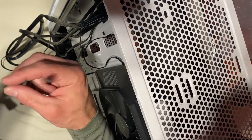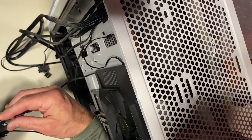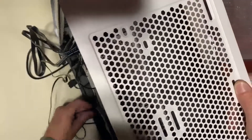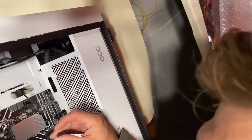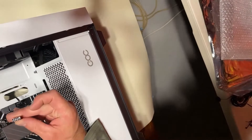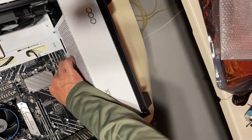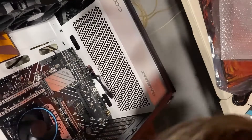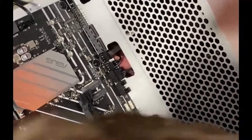You can plug three-pin fans into four-pin headers or four-pin splitters. If you're using a fan splitter, just make sure you line up the clip and that will align all the power, negative, and signal wires. If you're not exactly sure how to plug a wire in, look at the end of it and find the missing pin — that's how you line it up.